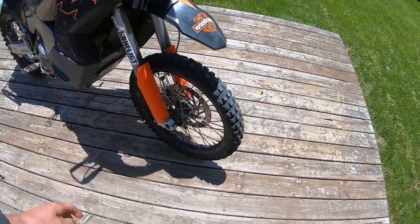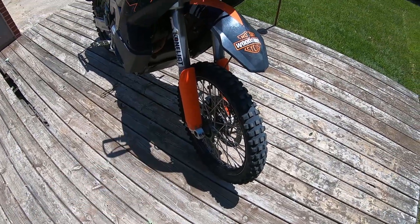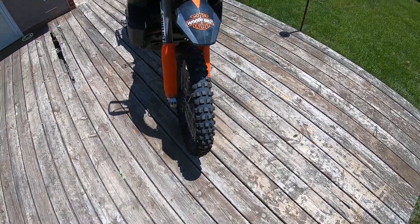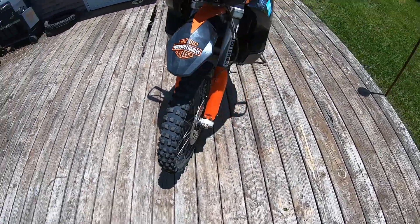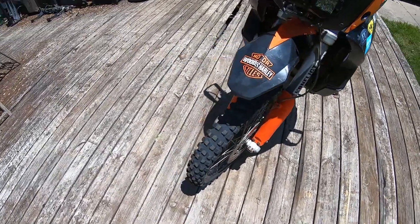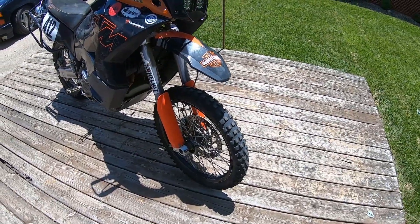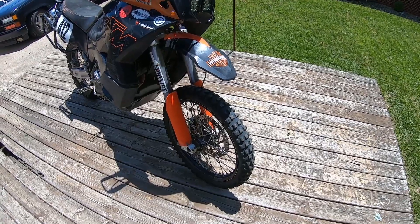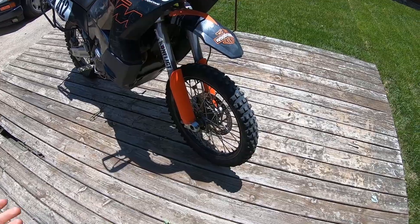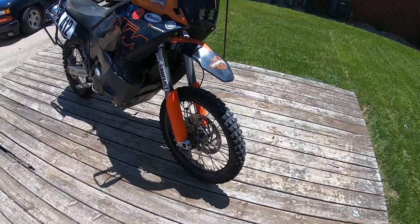I've got the Rad Hub on there. It's a single front brake — I took the caliper and the rotor off on one side. It does have a Super Enduro Brake Master to get the hydraulic ratio correct. You have to run pretty aggressive brake pads to deal with stopping a big heavy bike like this. I run the EBC Double H — they're like a sport bike pad actually, but they work pretty well. You've got to get a little heat into them before they work really well, but that's not hard to do on a big heavy bike.